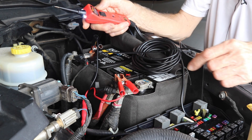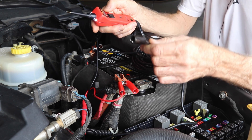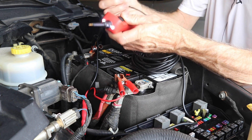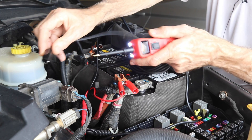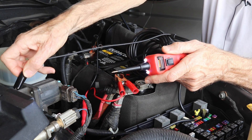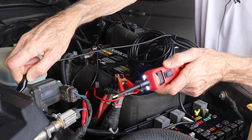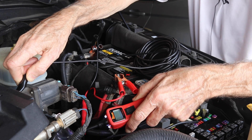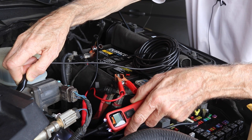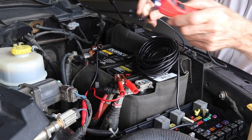It's got various modes, which I'm not going to get into too extensively because we just don't have the time. Now, they've got this little pigtail here and that's a negative, and that's what you use to check continuity. So if you wanted to check continuity between, say, like this piece of steel over here on your intake and on the EGR valve here and see if you got continuity with something else on the truck — you can see I do. Can you see the green light? Yes, so that's just checking continuity, that sort of thing.